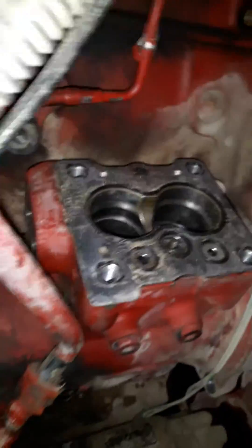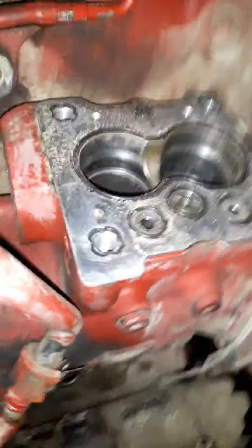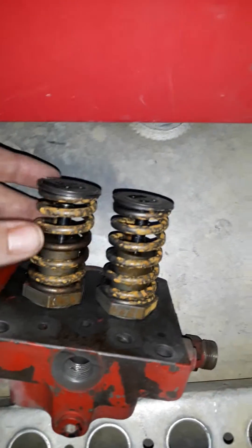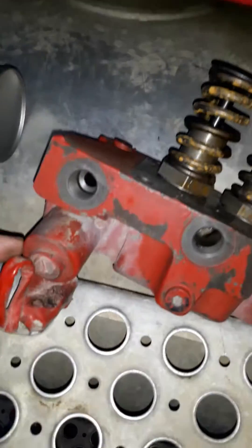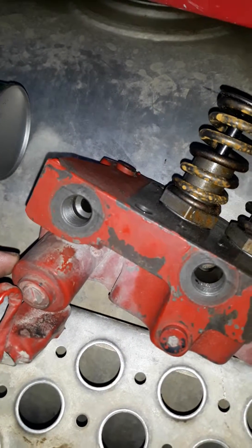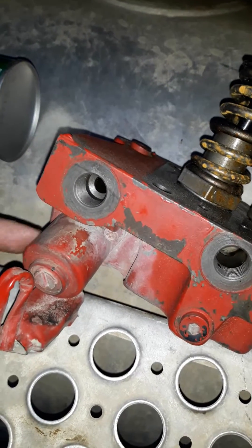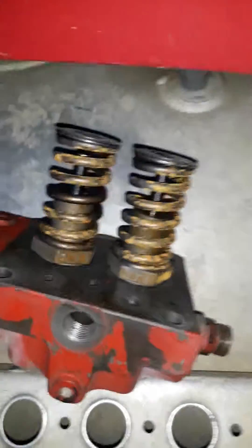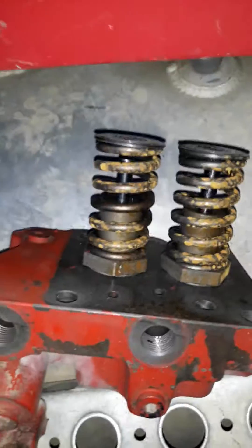Then it goes to the common rail and all that good stuff. Of course there's our high pressure relief valve, but we got one that failed so I thought I'd shoot a quick video. This is what they call the head, these are the plungers or pistons that make the pressure — right here. This is your pulse width actuation, which controls and varies the pressure. For those of you that haven't seen one apart, I thought I'd shoot a quick video so you guys could see it.